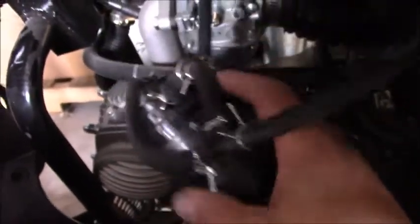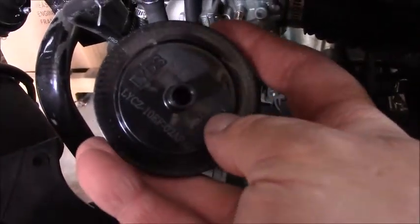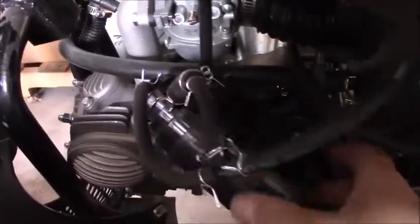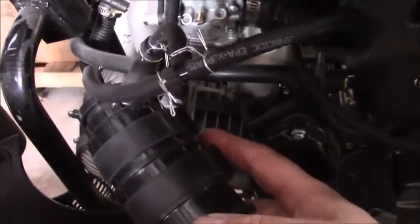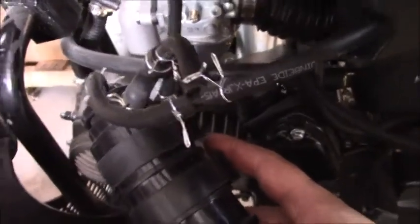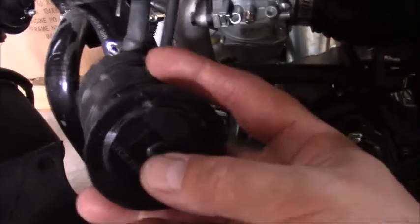When does it become tricky? This device is fitted with a check valve right at its base. The purpose of the check valve is to allow atmospheric pressure to act on the EVAP system and prevent the gas tank from experiencing too low a negative pressure. If the pressure in the gas tank is too low it will obstruct your fuel flow, and you'll have issues like stalling in the middle of nowhere — downshifting from third gear going through a turn and the bike stalls. The reason for this is the check valve having some difficulty.